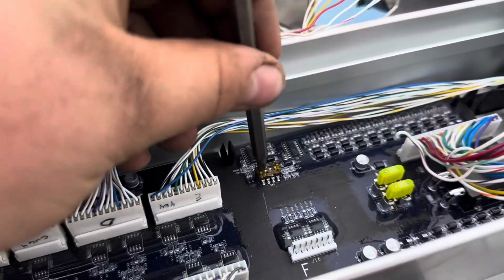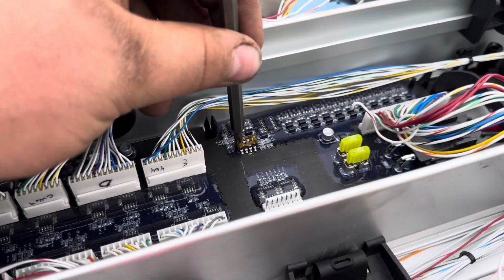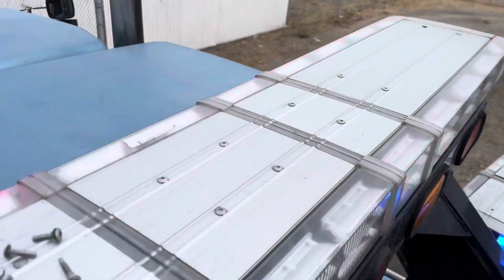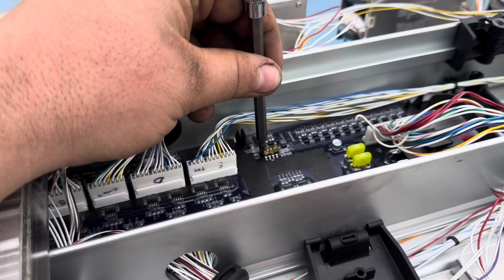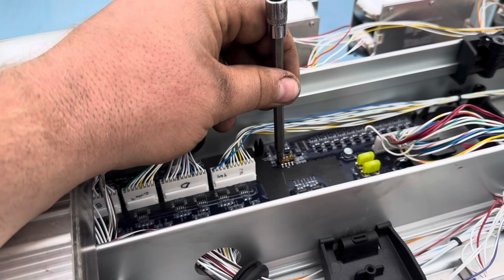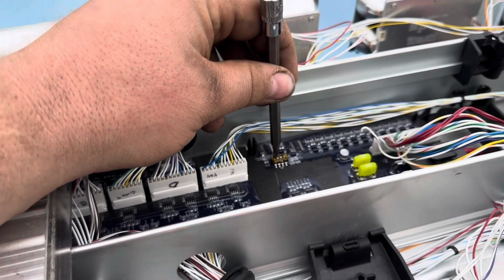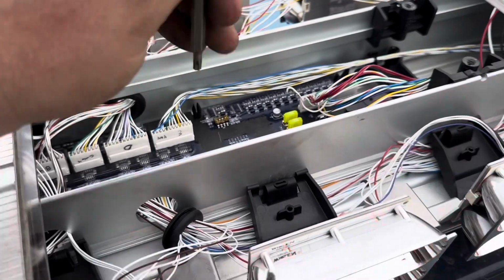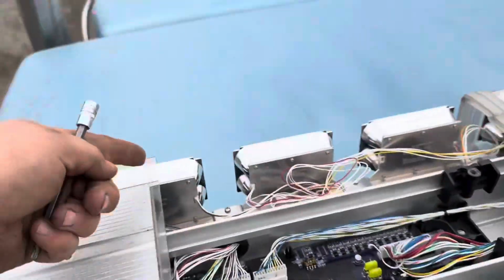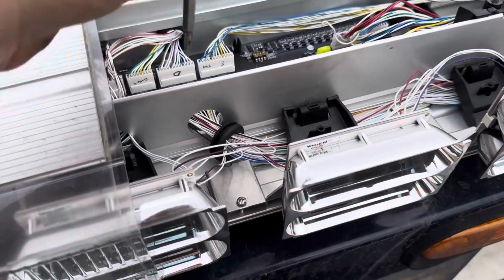You see your dip switches here. Your dip switch 4, I think that enables your low power on your tips of your light bar, the corners. From the factory, it will not dim those to meet the NFPA or whatever the acronym for the fire trucks, the lighting protocol. 2, we'll switch the front of the bar backwards. So say the TA is over here, but you mount the bar the other way so your TA is in the front. Flip that, vice versa as you need it.